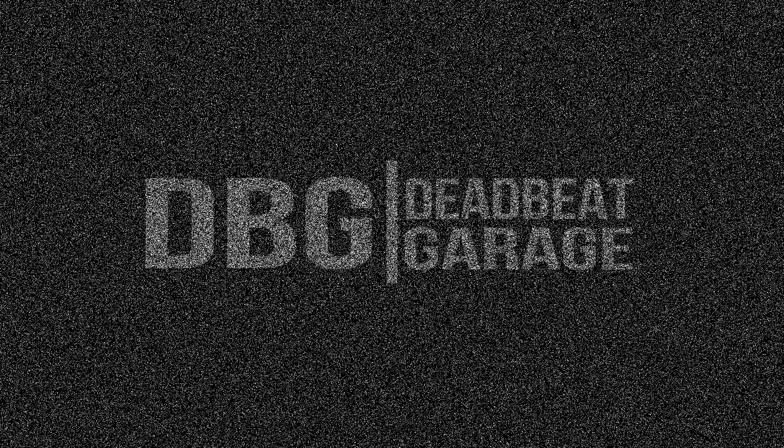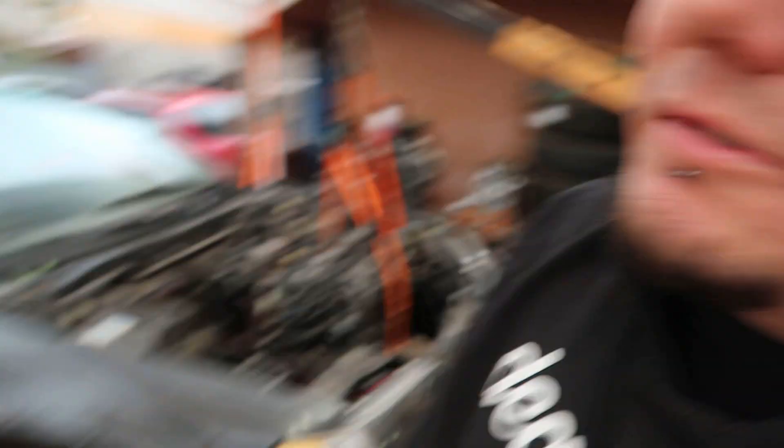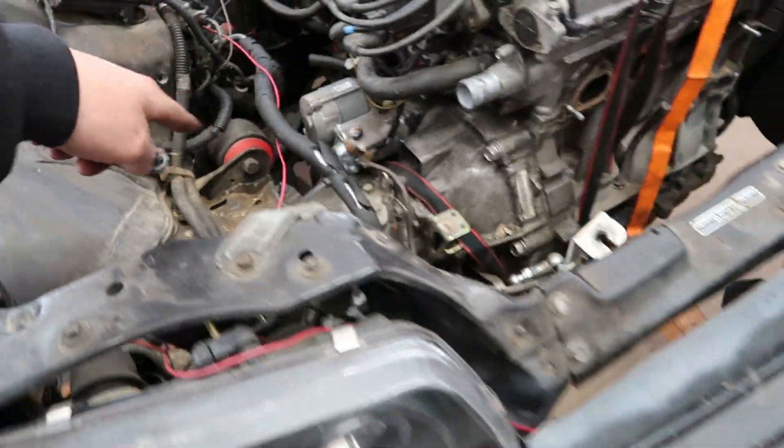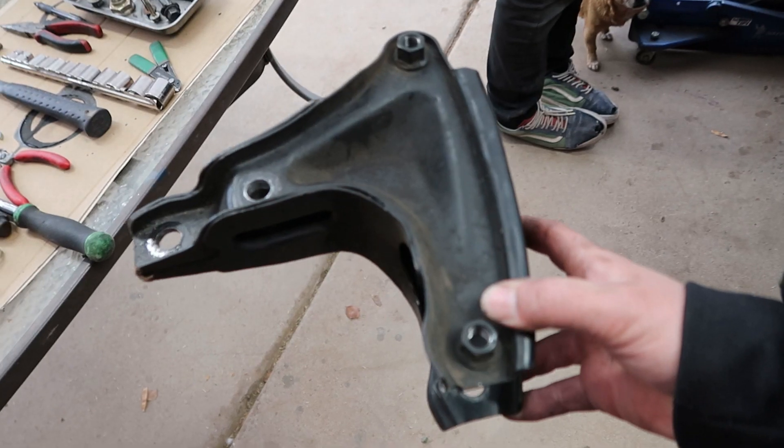Made it back home, and it's raining again. At least it's not raining hard. I knew it was going to rain — the forecast said around noon and it's now almost 3. That's why I set the car up on the concrete up here. We were basically ready before I left, so now all we have to do is get the T-bracket out, take the bolts out of the motor mounts, and drop the engine. T-bracket acquired!